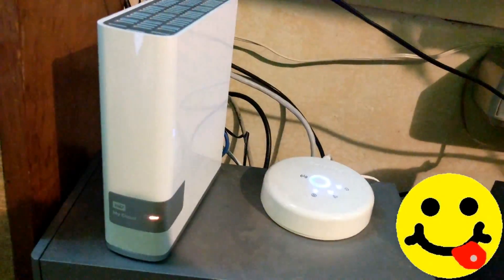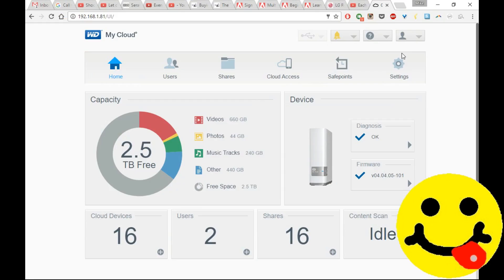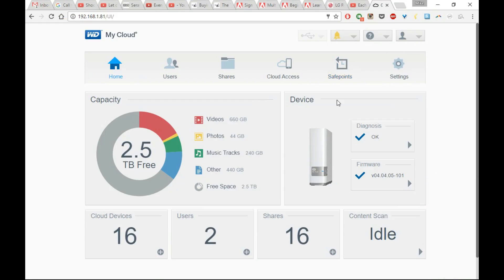You can see here the My Cloud is disconnected and it's flashing orange, which indicates that it does not have signal. If you go into the user interface using your IP address, you can either connect your My Cloud to that four-port switch and then to the router, or connect directly to your computer using the Ethernet cord.